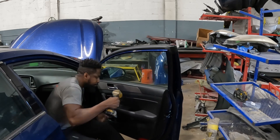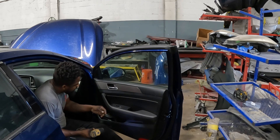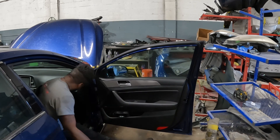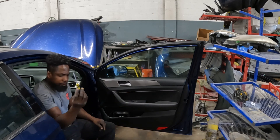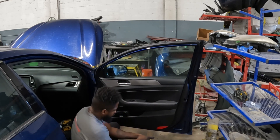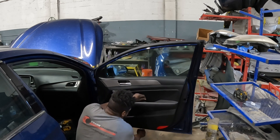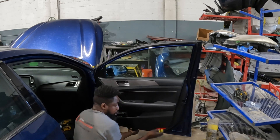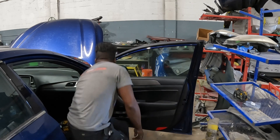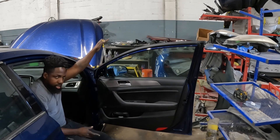It's a Phillips guys, a Phillips. Take that one out. Once you take those two screws out, put your flat head right beneath the groove right here and pull the trim panel towards you — see that, right in the groove, pull it towards you just like that. Now you're going to put your hand underneath it and pull it out just like that. See it comes out. Now go ahead and take that piece off — flat head, put it right there, snap it out.